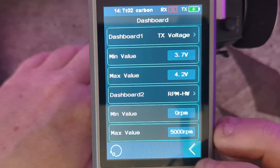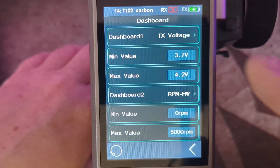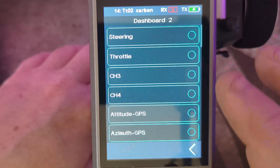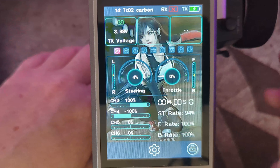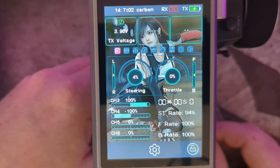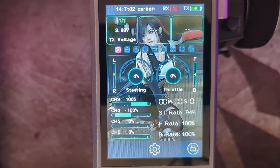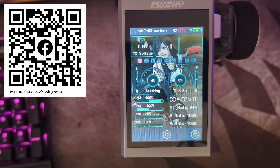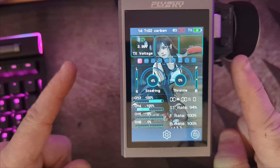This would be reading RPM, so you could have speed and RPM together — working as a speedo and a rev counter. You can change it back at any point, and if you want to reset anything you can just press that and it'll reset them back to stock. That's a quick guide on what these dials do, how you change the settings, and how you calibrate them so the gauge reads correctly. Thanks for watching WTFRC Cars — if you like this content, like and subscribe, hit the notification bell, share with friends and family, and catch you in the next one.